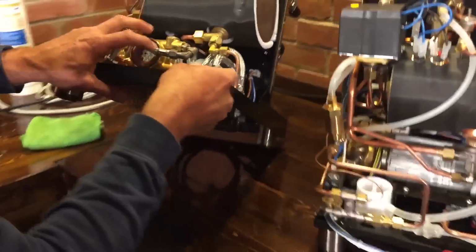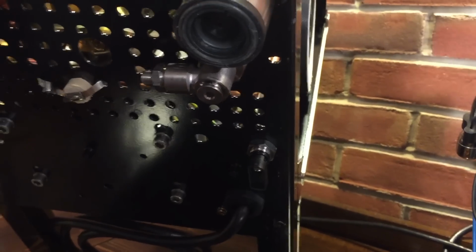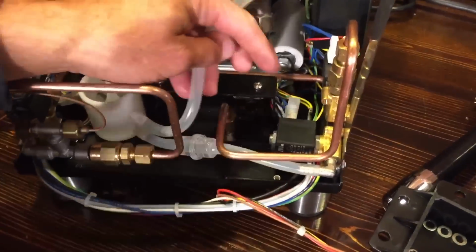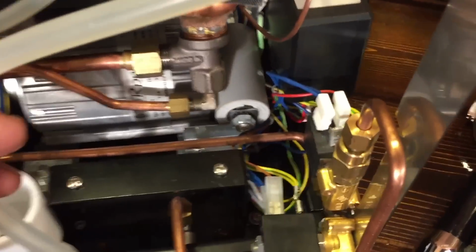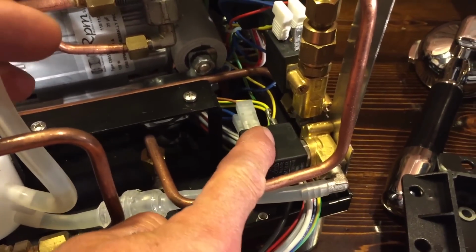over here. So that's the ECM we're looking at? Just go like that, flip that valve over, and now you're in water line connection. So that's a mechanical change as opposed to using an electrical solenoid. Correct, which is what the Rocket has, two solenoid valves over here. One takes the water line, and this one takes water from the reservoir.